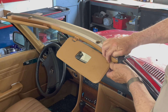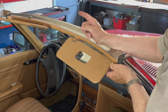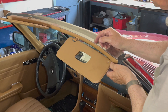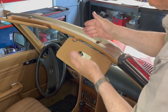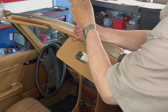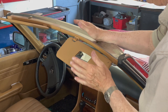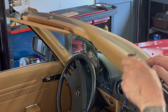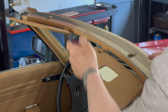Be very careful when you tighten the screw down or you can strip the plastic in there. This is one of my complaints - the other side was stripped upon receipt of that left-hand visor, so I had to get an oversized screw. The fact that you have to mess with some of the fit, there are no instructions, and I had a problem with that screw - I'm going to live with it rather than return it. Just keep that in mind when you go out to buy a set of these replacement aftermarket visors.